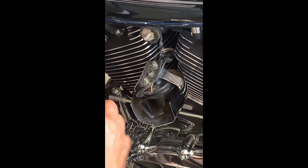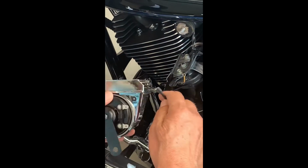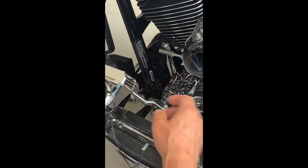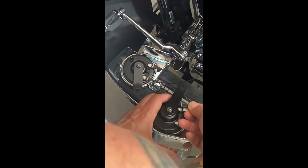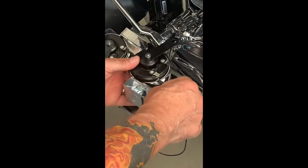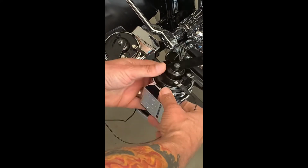So you take this horn and you take one of your V's and you put one connector on here, and then you take the other one on this side. Then you take these 2 and you connect the other horn. So you have to have a closed circuit. So this way, once we hook it up to this horn, you'll have a closed circuit between all 3 horns. And put the connector there. You have your horns all hooked up.